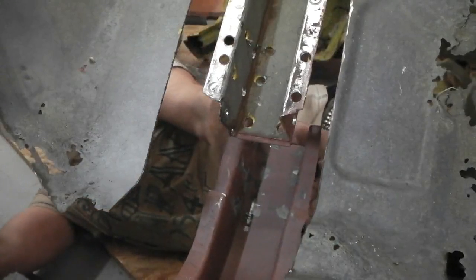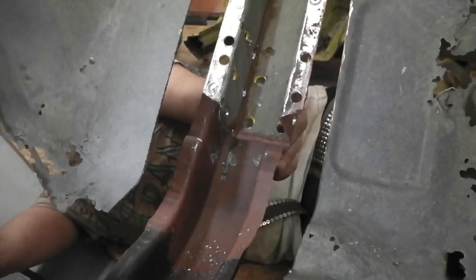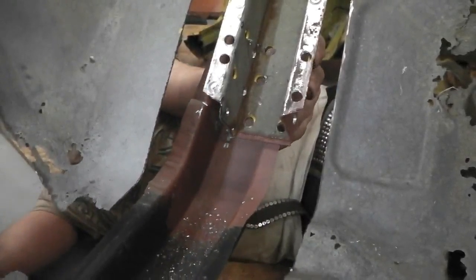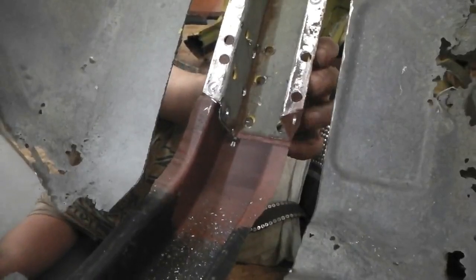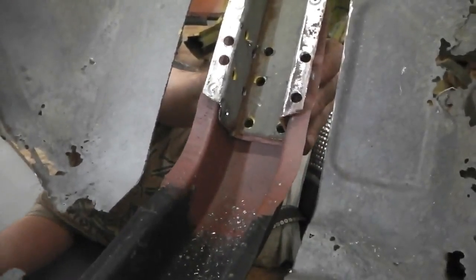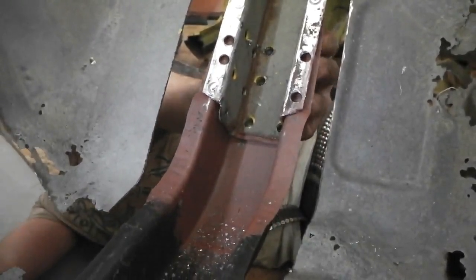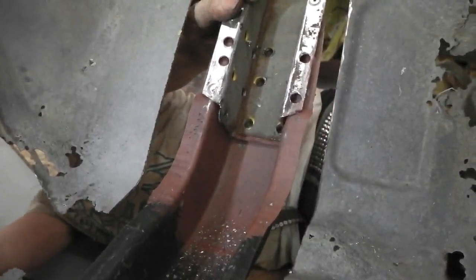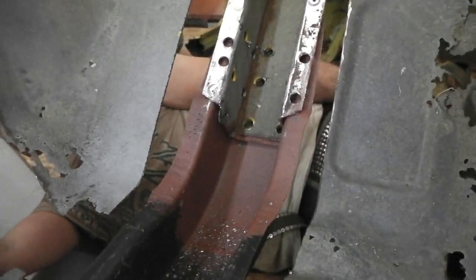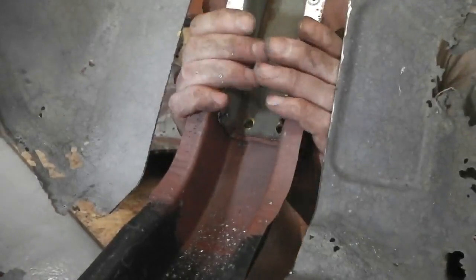So that makes its journey and meets where it's got to go. Our holes are there, ready for the plug welding to take place. Just a thin coat of the rust.co.uk primer. That's a two-pack primer. I think it's the best. It's a very low burn back. I've said this earlier on when we used it on earlier films. But not too thick, or you do get problems getting the weld started. I clean the plug holes out first anyway, so the weld goes straight into clean metal. But if there's too much primer on there, you do start getting some fumes coming off it.